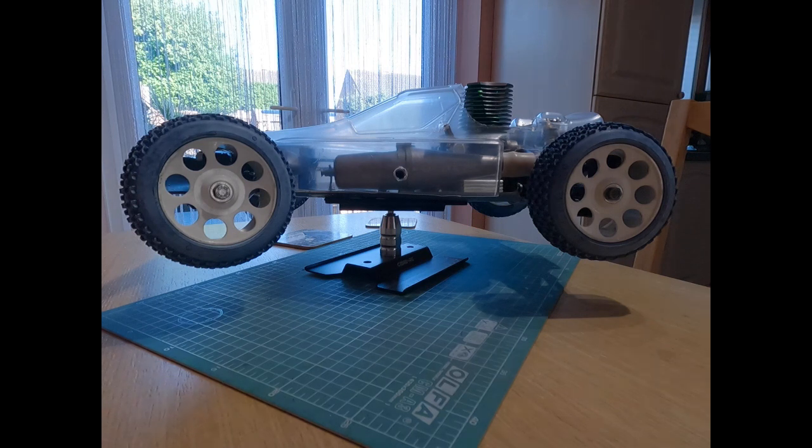I've since purchased other Asmon motors - a .28 - but this is the .21, and it shouldn't be much different. This is an untested engine. The problem with secondhand nitro engines is you never know the full history. I've got nitro engines that don't seem to have much compression yet they work quite well. I do keep my nitros in good condition - I strip them down. The only things I don't replace are pistons, sleeves, or con rods. I replace bearings and seals and nuts and bolts and make sure they're clean. They're a very simple mechanism - a two-stroke, really a two-stroke diesel, which is pretty much what nitro is.